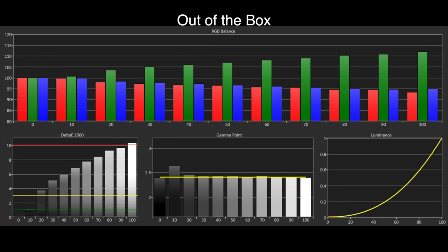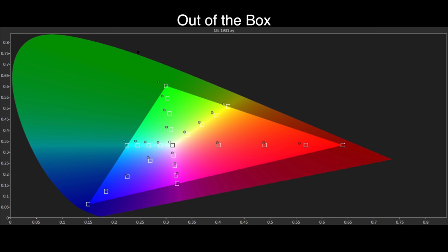We used the movie picture mode as it's the most accurate out of the box to the industry standards. The grayscale results were a little high in green which pushed our delta E errors above the human threshold of 3, and we could see a cyan-green tint to images with actual viewing content in the movie mode. Gamma is good and the darker rise at 10% stimulus is caused by the local dimming system not being quick enough to match the meter taking the measurements — so we are not really concerned about black crush, and none was visible in ramp patterns. This is not a perfect result out of the box. Looking at the colour gamut for Rec.709 coverage, the green push in the grayscale is visible here, but by fixing the white point in grayscale we expect it to drop back to being almost perfect.